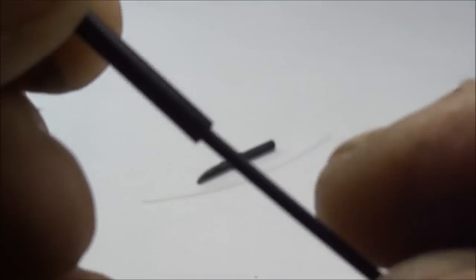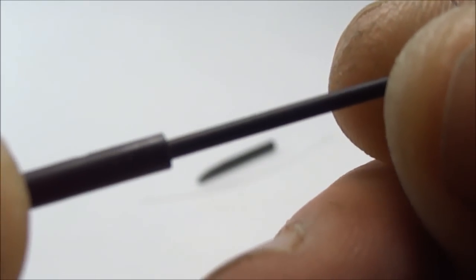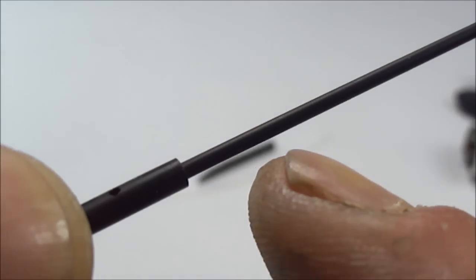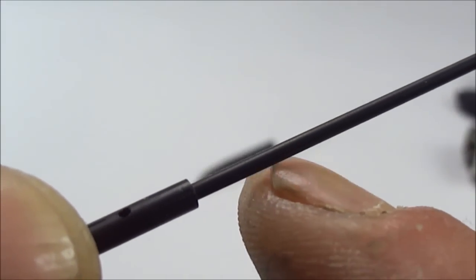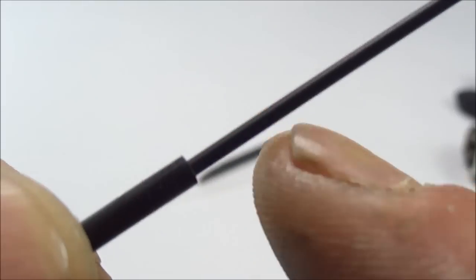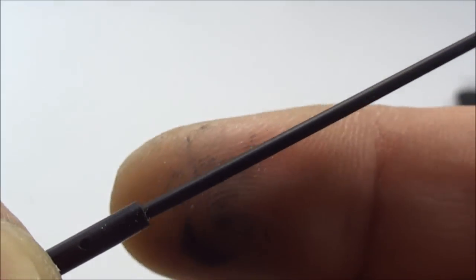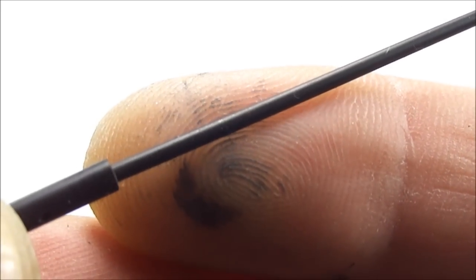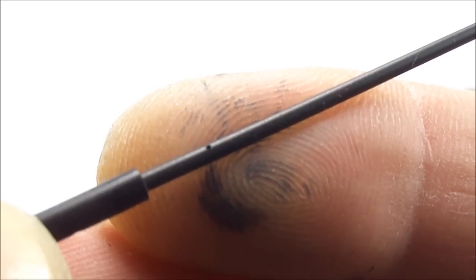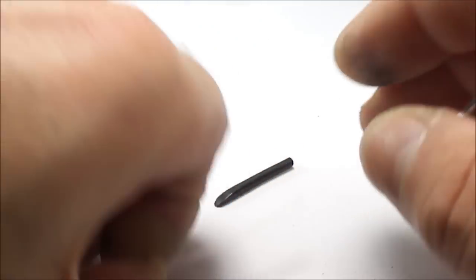You'll also find that approximately about eight to nine millimeters down — I'm actually twirling it around so whether you can see it or not I don't know — but approximately about eight millimeters down on the breather tube there's actually a small hole. So the breather tube needs a small hole just below the feed, approximately about eight to nine millimeters down. If I just put my finger behind — there you go, you can actually see the small hole in the breather tube.